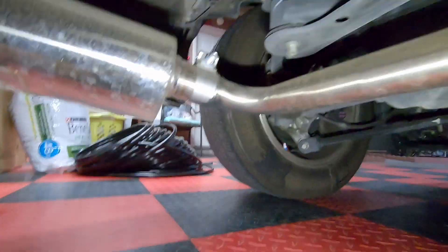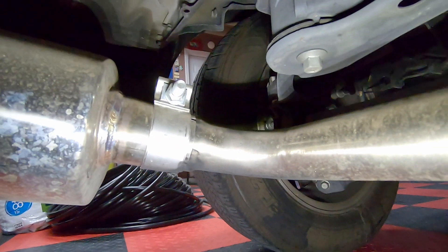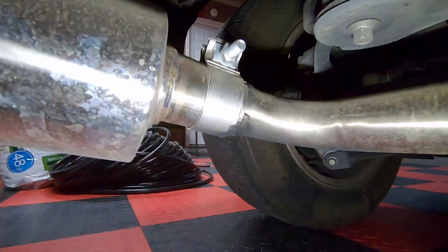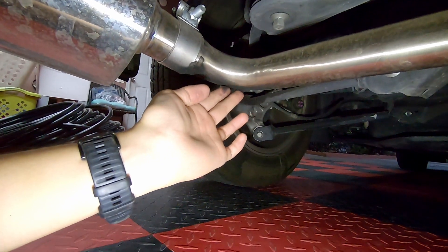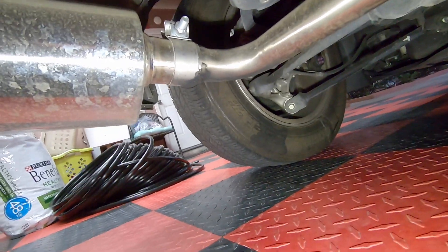So this is the game plan. My exhaust is a bunch of pieces, but essentially what I'm gonna do is loosen this part — loosen that main connection right here — and then with the jack I'm gonna put it on this point, lift it until it's at least flush, and that should fix the problem.